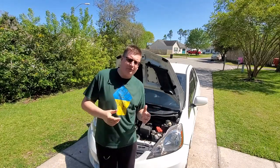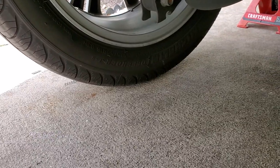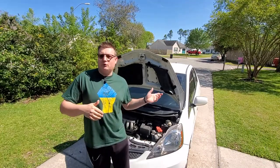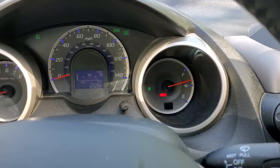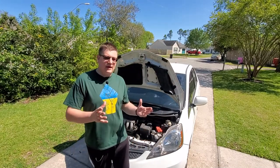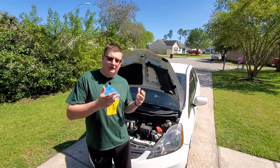Now, what about brake fluid leakage? You're obviously going to notice brake fluid residue on your driveway or wherever you park. Secondarily, over time, the brake fluid will actually leak out, and the sensor will tell you on your dashboard that you're running low on brake fluid. And you're obviously going to notice how low your reservoir is. So in this case, it's just the master cylinder. There are no other options. So let's go ahead, get this car on the ramp and start working on it.